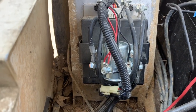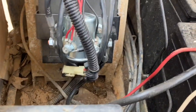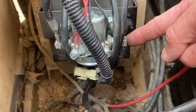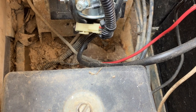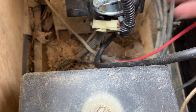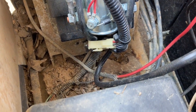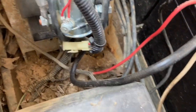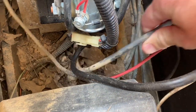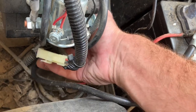It's the same loom that the black goes to, which feeds into the lights — so another accessory drive, not connected to the motor. This is all the charger stuff. The positive — the black positive — follows down to the driver's side of my box here. I don't remember the name of it, but once you get to that, that's really all it is. This whole control just goes there. I figured this out because that's how it was when I first got it — I just reversed everything from the six-volt swap. We take this off-road, so it's full of mud and leaves.